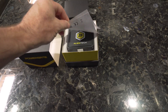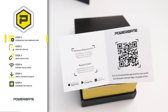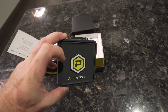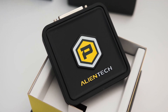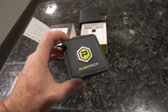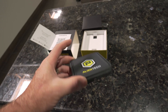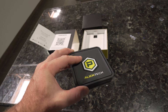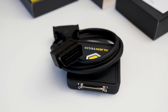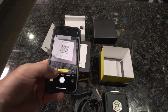The user manual has a QR code which we need to scan to download the app to our phone. Here's the box — this is what's going to go into the car and connect via the cable. It has the Bluetooth module inside. When we send you this box, it's already registered to us — specifically to VR Tuned. If you have one from another tuner, we can't use it because they're assigned directly to each tuner's master tool. We also have the OBD2 port cable that connects to the box.